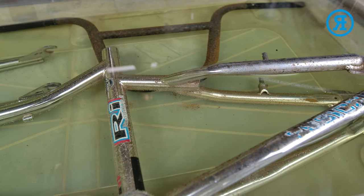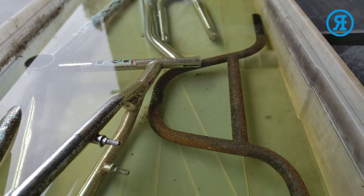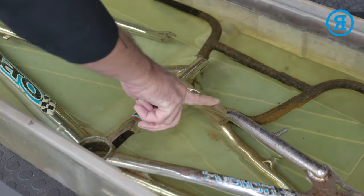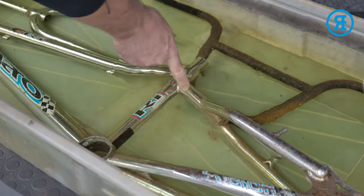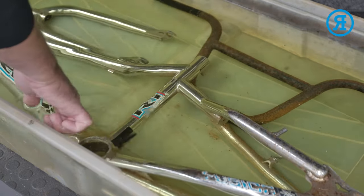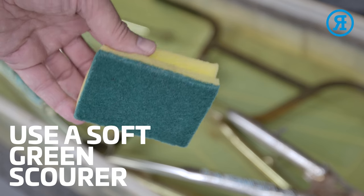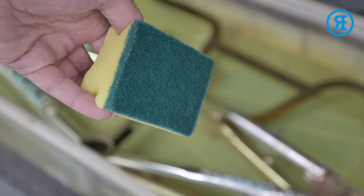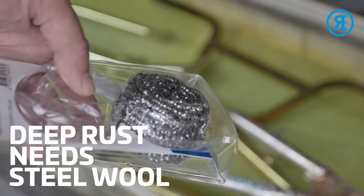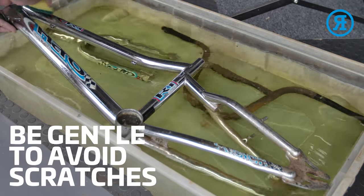So it's been 24 hours now. The frame's been in the bath. As you can see, the rust is literally falling off the frame. Even with just a gentle wipe with my finger, the rust comes off super easy. The next thing we'll do is use a kitchen scourer to give the frame a good wash down. For really deep rust areas I'll use some steel wool — that'll probably be what I use for the handlebars. You don't have to wipe particularly hard; just like washing the dishes, you can wipe away the rust.